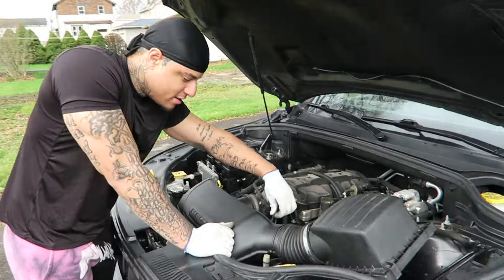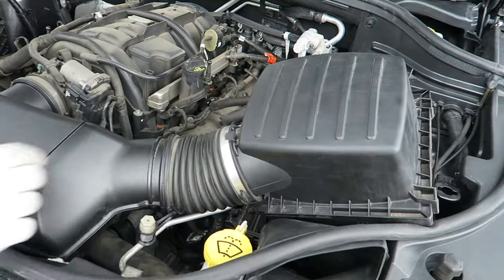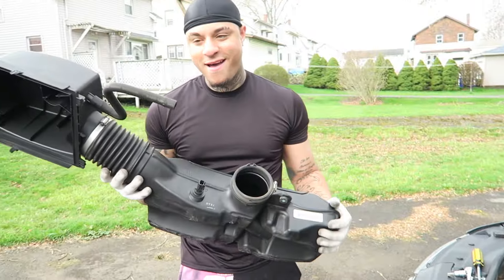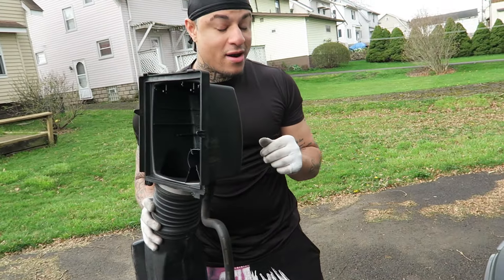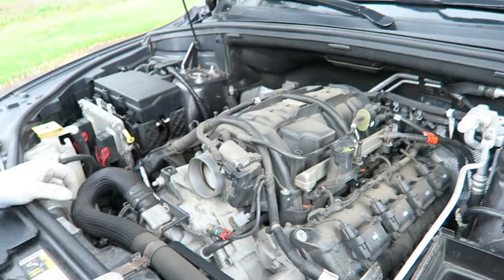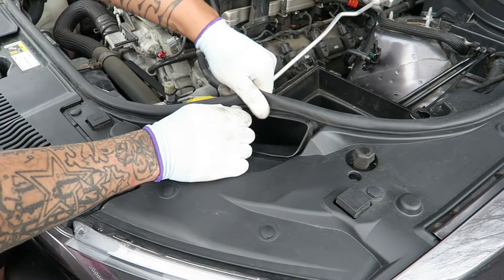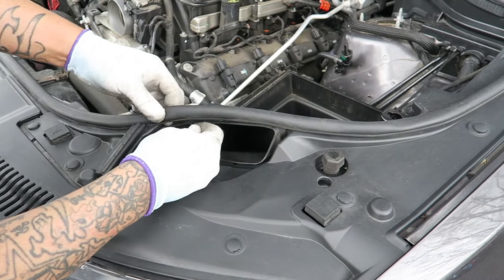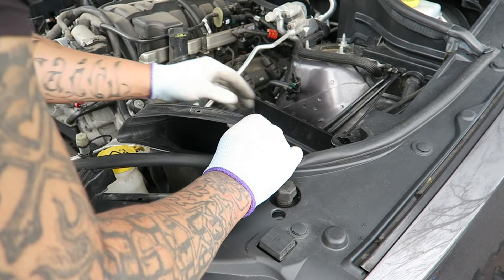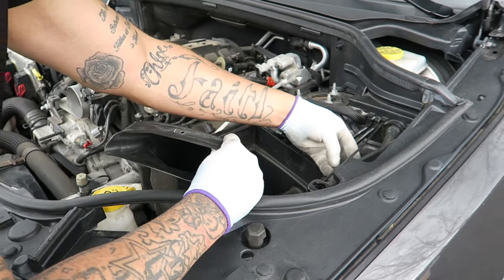Based off of it, you have to pull this part off right here, which is connected in. I ended up taking the clamps off, I took this screw off — very simple steps. I unscrewed this, so at this point this should all just pop off. Now as you guys can see we have the throttle plate right here. We got off every piece that we needed. Now this part has to come out — based off of what they said on the video I watched, you just pop this out right there and then this should just slide up out of there. Oh no, is it about to rain? Yep.